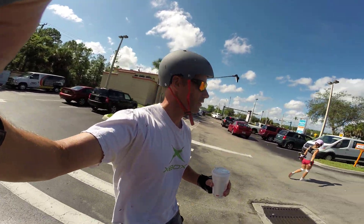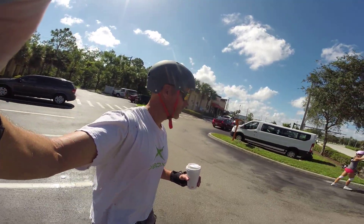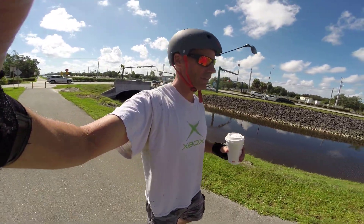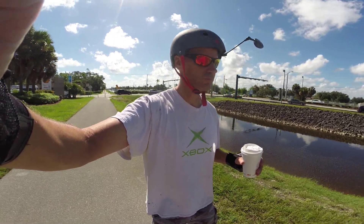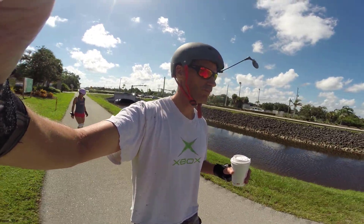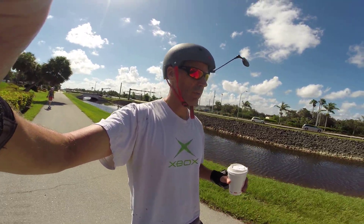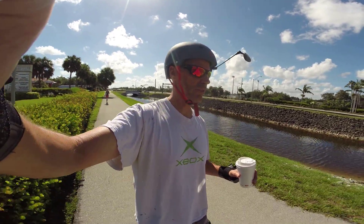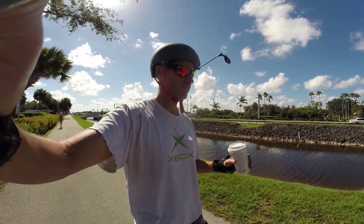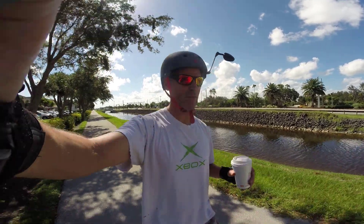Yesterday on the ride I mentioned it was weird that the battery only charged to 76%. I charged it again last night overnight and it only charged to 76%. I had my wheel charging all night and it still did not charge to full. I was pretty sure I had a problem, so I posted on the Electric Unicycle Forum. Someone suggested I check the voltage coming out of the charger — I put my meter on it and it's outputting 85 volts, so it is not the charger. But fresh off the charger, the battery pack in the wheel is only showing 77 or 78 volts.